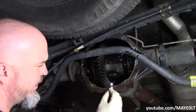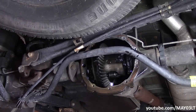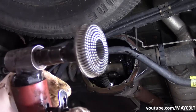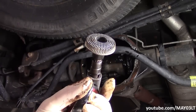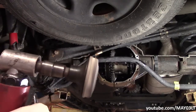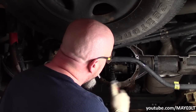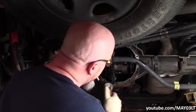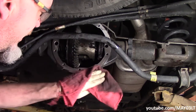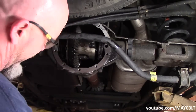You can see even though we took a big chunk off, there were still some little stragglers hanging on. In a shop environment you really don't have time to go over that with a razor blade, so I'd use one of these little plastic grinding discs. These things are great because they don't dig in and scar up the surface. If you are going to use your grinder, wear safety glasses. To check your progress, spray brake clean on a rag and wipe — I don't like spraying brake clean directly into the differential itself.